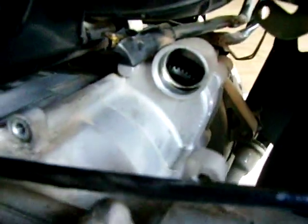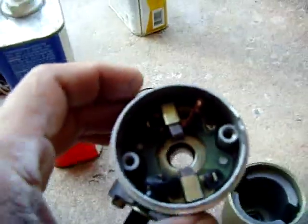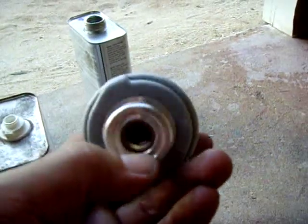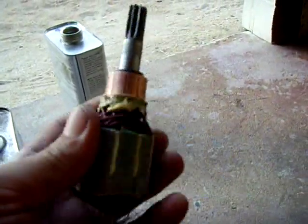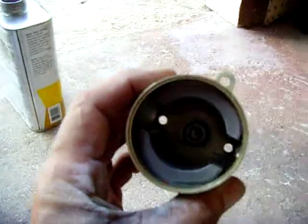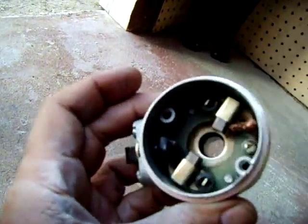This is the inside of the GY6 starter. Right inside this hole there's an o-ring seal on the inside, just like there's one on the outside, and that prevents oil from being pulled from the shaft into the motor. I took my starter off and it was full of oil — this entire starter, the whole housing with the magnets, full of oil. I cleaned it — the two brushes, the plates — completely filled with oil. That's a manufacturing defect.